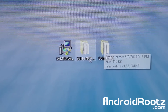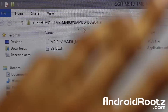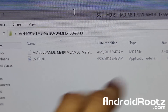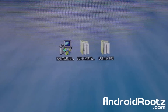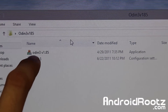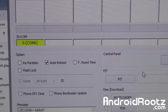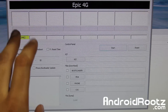The stock tar file comes as a zip, so right-click and extract it. Once extracted, confirm it shows as an MD5 file — it has to show up as MD5, so keep that in mind. Now open up Odin 3 version 1.85 — make sure you open the application file. Select yes to grant it and let it open up. One thing everyone must have to detect the phone is the yellow bar in Odin.